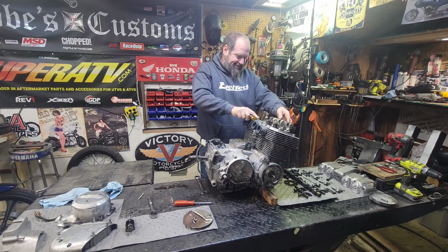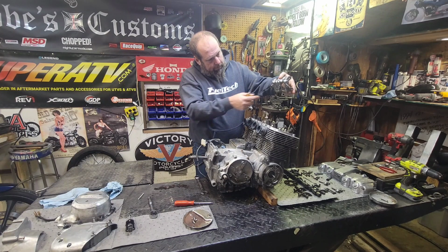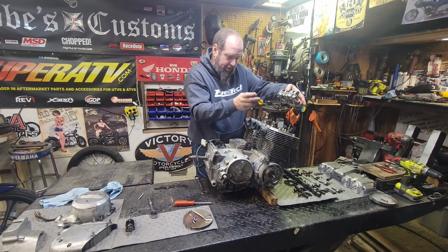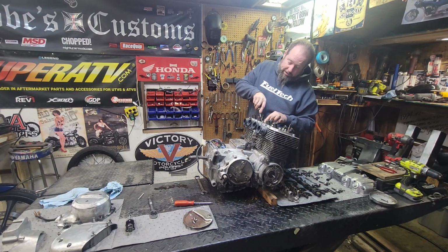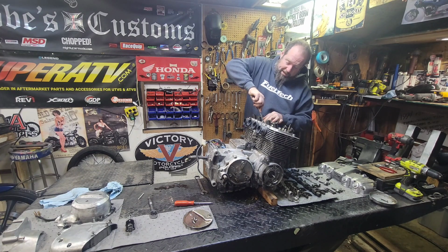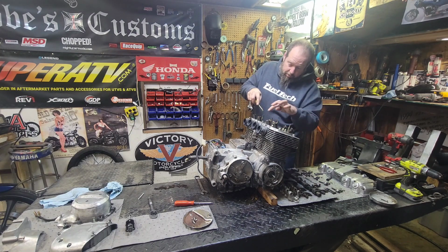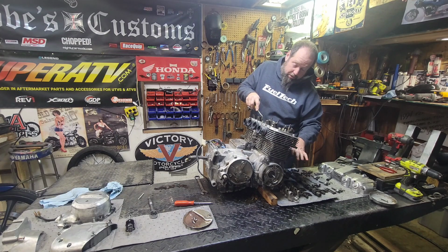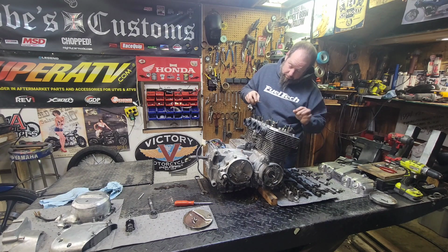Oh yeah. Shit coming apart. Yeah, see the plugs came out on this one. Bolts are down in here. Plugs got to come out. So I recommend replacing those too when you assemble it, or at least make sure that they're sealed with the head. Otherwise you can leak pressurized oil. I'll show you here in a second. The oil pressurized ports are right here. That's what filled these cam holders with oil pressure. You don't want to leak. You're going to have full oil pressure right here going into those cam journal holders. So make sure it's all good.